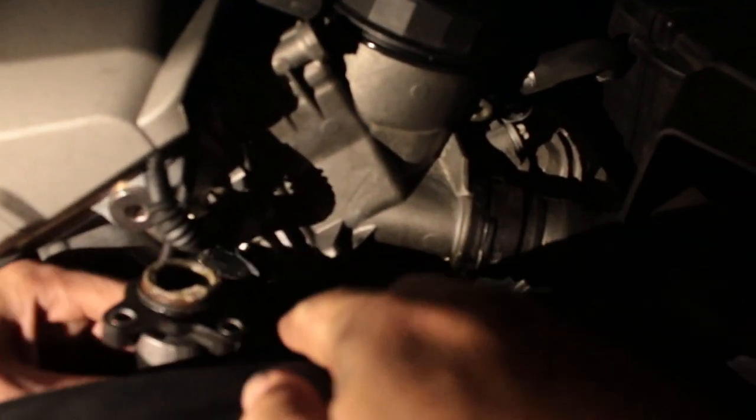So we did end up taking a hose out of the way so we can unscrew it. But that hose had all the coolant inside of it, so we had to drain all the coolant first. So we'll show you guys what we did. So that's your top radiator hose right there, right? It connects into here, and that third bolt you guys need is right there.